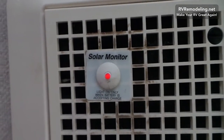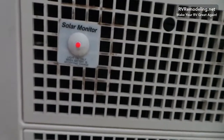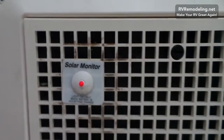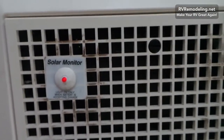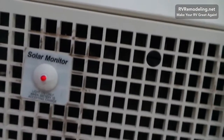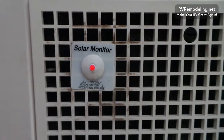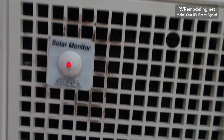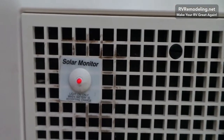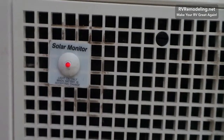But I think 45 watts is overkill, and dangerously high for the thin wiring that this runs on. The 15-watt will give you enough juice to keep your battery charged — slowly trickle charge your battery from the sun and make sure you never have a dead battery. It will never be enough to run your whole coach, and 15 watts is low enough that it won't burn the wiring — not enough current or amperage. Just about one amp. So it's pretty safe to run and cheap enough, and it works. That's all you need — to keep your battery charged.